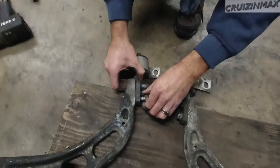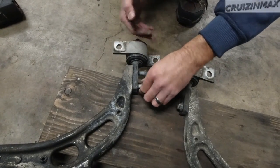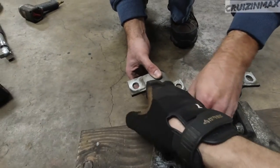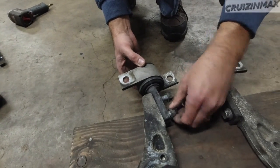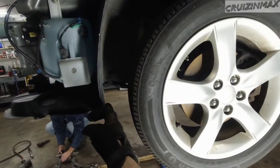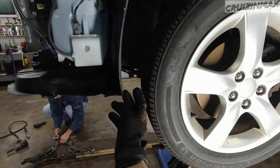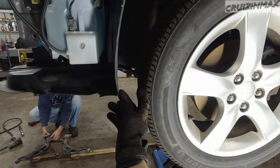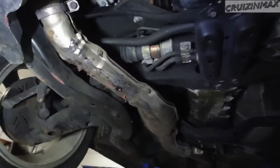Yeah, that's basically what the anti-lift gives you. I do have the anti-lift kit, which is just these bushings with these brackets, on my 06 STI, and that gives you a little bit more caster, brings the whole wheel forward this way. So if you look at my 06 STI, this tire would be right about here, maybe an inch, maybe even a bit more forward. And I can show you what it looks like underneath.